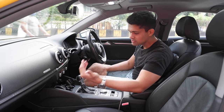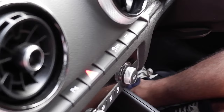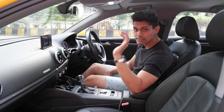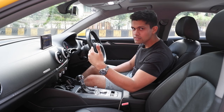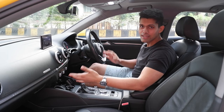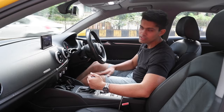The steps remain the same: start the car, switch off the AC. But here's what's important in this car — there is an ESC button, but unlike the other car where it directly switches off ESC, this car has two or three modes. There's Normal, then there's Sport ESC which helps a little but still cuts power. If you hold it down, it goes into Sport, and if you hold it down further, then it goes off completely — so that's important. Also, there are no paddle shifters in this car, but you use the gear selector if you want Manual. Sport lets the system decide what should happen. So let's go.